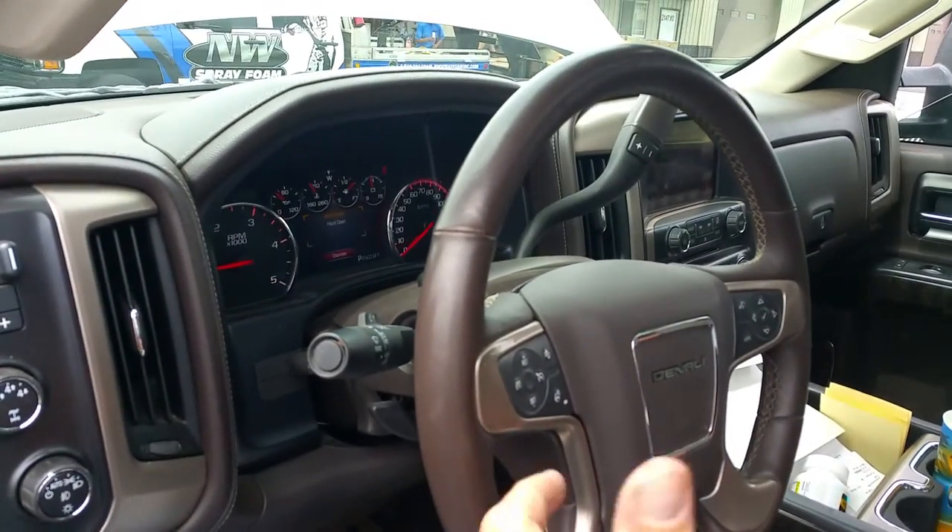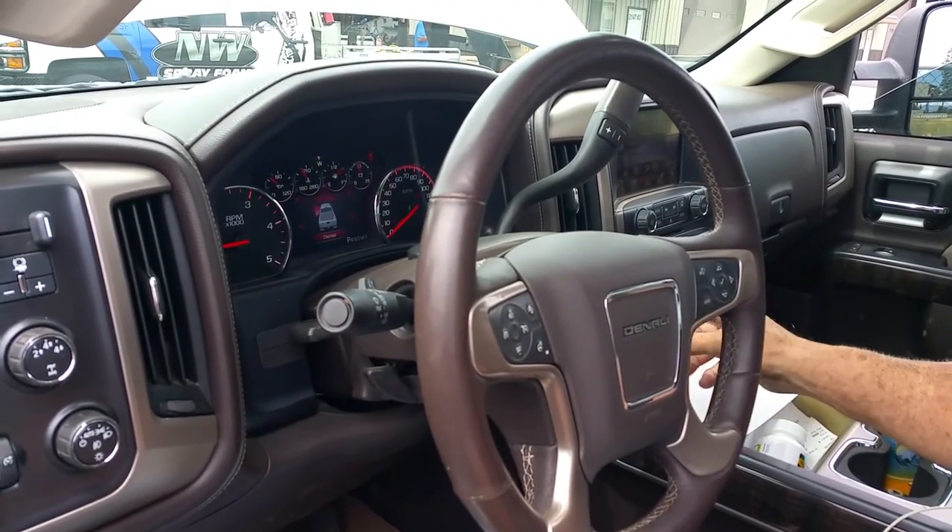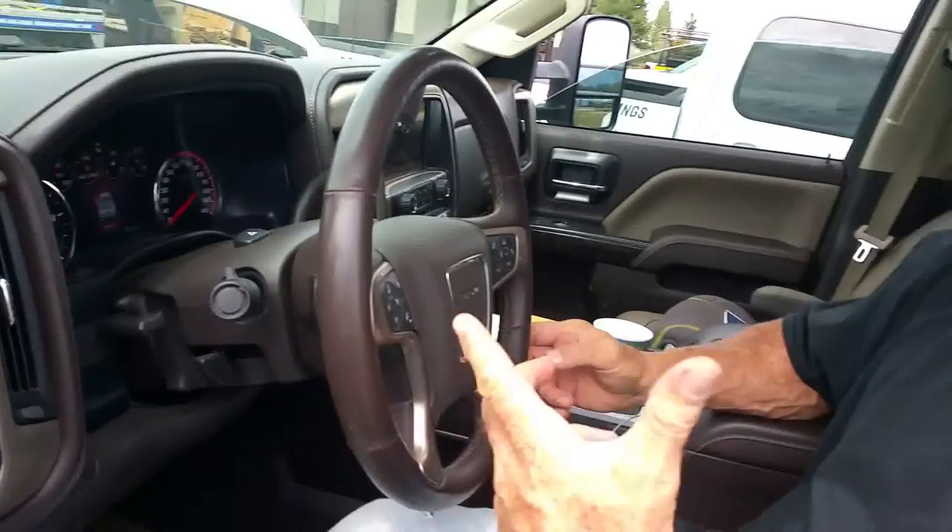It's going to show like our hood's open. Also, when we plug this in, the sensors themselves can sometimes stay powered up for a lot longer than people think. So sometimes you get a check engine light — once you unplug that sensor, the truck already knows you've been unplugged, even if it's been off for 5 minutes, 10 minutes, or an hour. We could get a check engine light in 100 miles or 1,000 miles, or you could not get one at all. It just depends on what the sensor reads. The check engine light is usually a soft code and it goes back out. It's usually an emissions light — no concern with the power or the running of the truck.